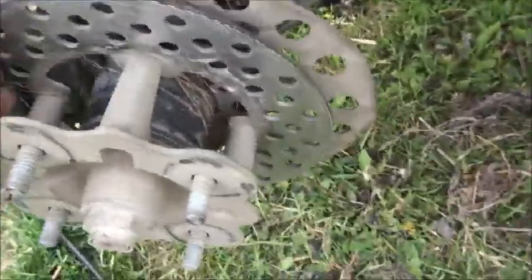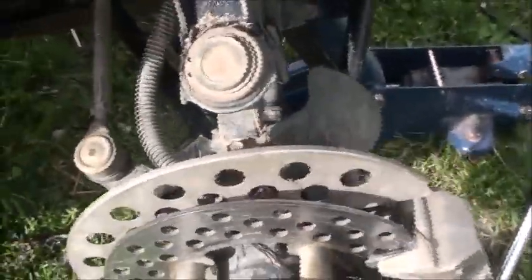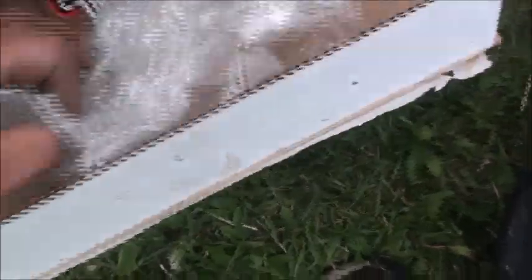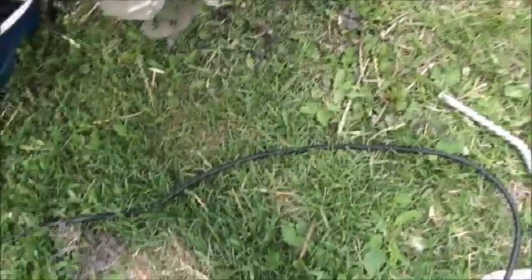So with that, I have to change this yet, whatever you call it, tie rod. They send new ones. This is what the new one looks like. It's a drop down one. I've got the other new one here. I want to change that yet. See, this side I had to move the brake line too, so at least now this side can steer. Before, the brake line was binding and it couldn't steer. Here's the other tie rod. Got the drop down. So I've got to change that yet, and cut the plastic. And the front should be ready.